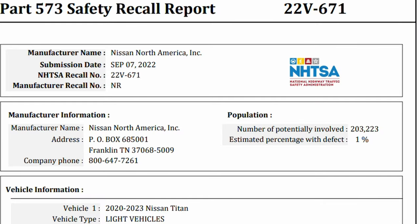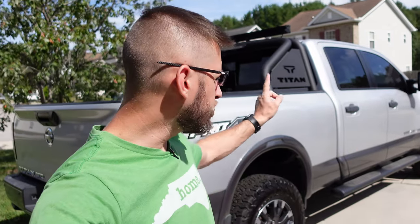Specifically, the 2020 and up Nissan Titan has had a little issue lately with the recall regarding the nine-speed transmission and its parking pawl's ability to actually hold the vehicle when in park. They've had a couple of trucks roll away, enough to spawn a recall, and there's been a bit of a delay with any sort of solution. We're going to show you in this video how to adjust the emergency brake on the second generation Nissan Titan, just to make sure you're able to set that and keep your vehicle from rolling away.